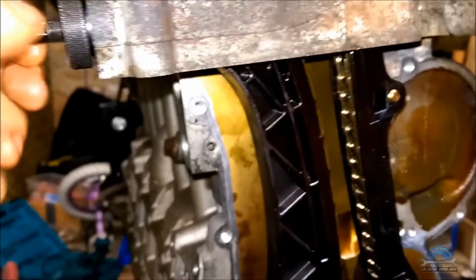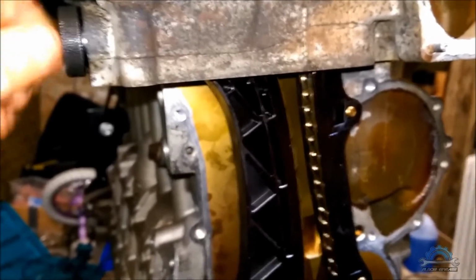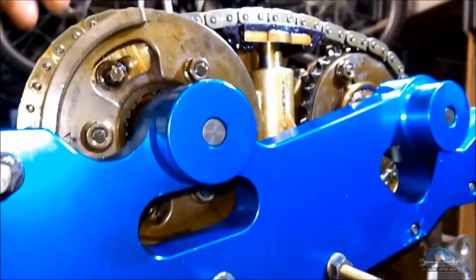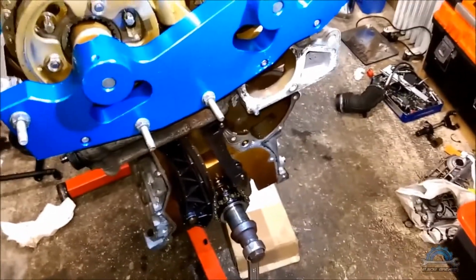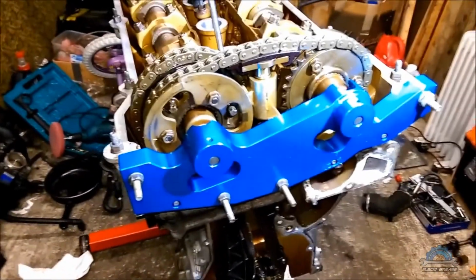I'm gonna show you. I'm gonna take it off again. You're gonna see you have a big slack, finger tight, goes back, that's it. You have a tension in here. The camshafts are locked. We have a top dead center. According to the crank pulley in here anyway, you're gonna see if something happens, if that crank pulley moves, you can stop, go back, adjust it again. That's how I did my M54. No problem with that. Computer showing each angle is fine. That's what you're gonna do.